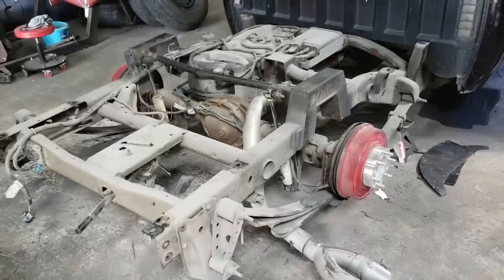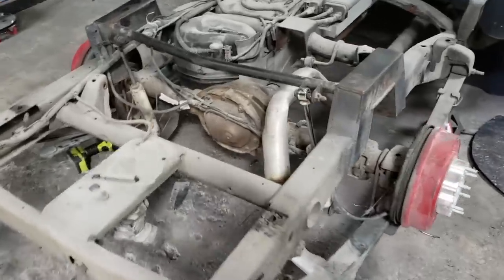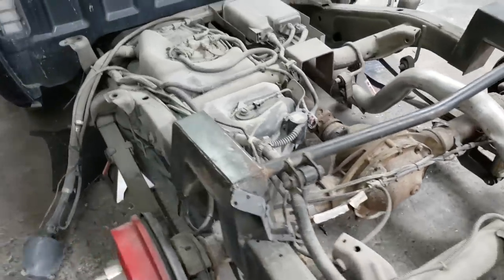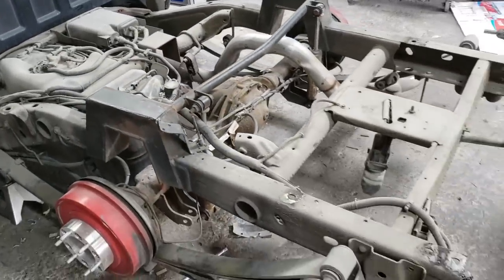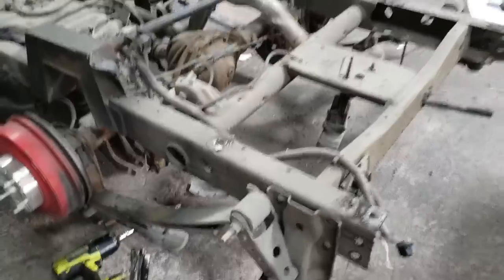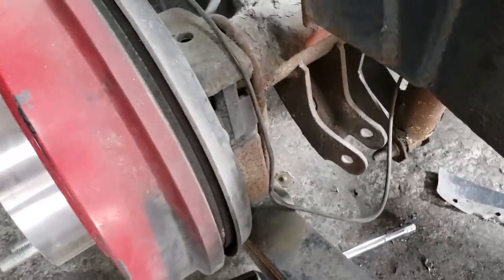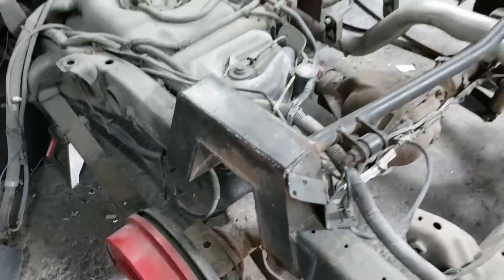Still has a lot of work. This is the back — after removing the bed it already has the notch. We're going to redo it to clear for the dually wheels, and we're going to be installing our wishbone coilover setup. That means the leaf springs, lowering block, flip kit — all that stuff is going to be removed.